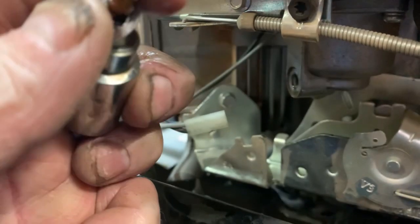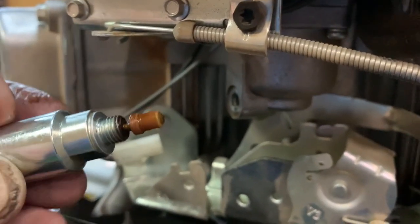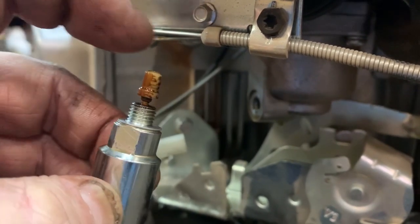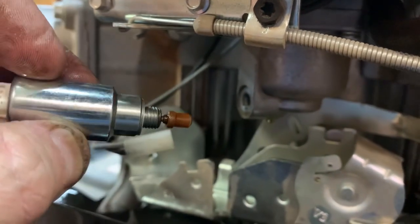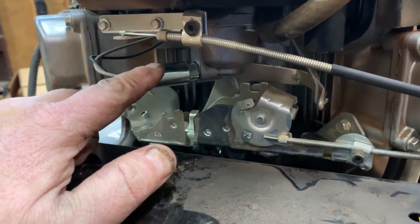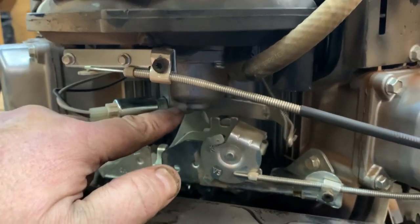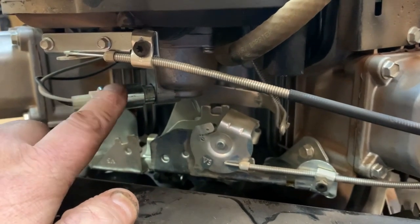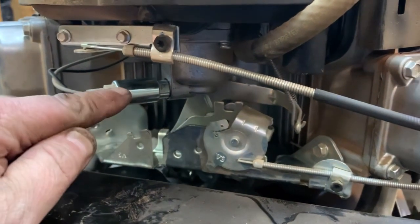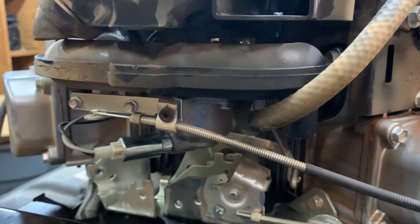You can clean these up, but you've got to be thorough, because if you don't get them all the way clean they'll work for a little while and then stop again. The absolute best thing to do in my opinion is just replace it. I'm going to try to clean this one the best I can. I could not get it freed up — it's so gummed up. I have a feeling the main jet may be in the same shape. What I did, since I'm going to replace this solenoid anyway, was take a pair of side cutters and cut the pintle off the end of the solenoid, which will allow gas to flow to the carburetor. Let's go ahead and give it a crank and see if it will run.